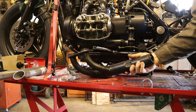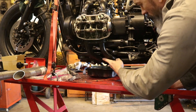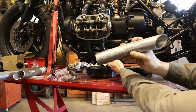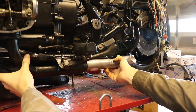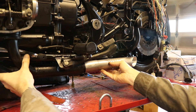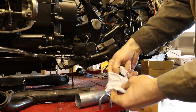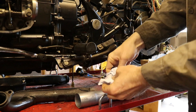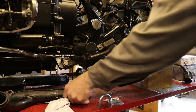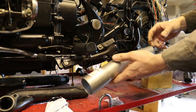I've got what's left of my stock exhaust here. This goes up on the bottom of the cylinder head and tucks underneath the frame a little bit. My basic concept is to attach this turnout piece onto the end, giving me a little out-turned pipe at the end. I'm going to use modern-day spring clips on this — like sport bikes use — with a spring on either side to clip the turnout onto the end of the stock pipe.